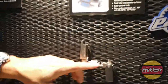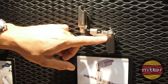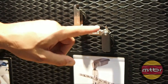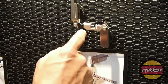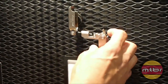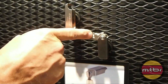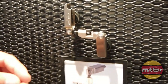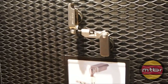This chain tool is a take-along chain tool that's 11-speed compatible — for Shimano and also for Campagnolo, because with Campagnolo you can push the pin out and push a new pin back in, but then you need to peen the pin over so that little anvil goes down and the bottom of the pin pushes against there so you can peen it over. Campagnolo requires that when you buy their 11-speed chain.